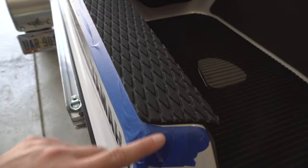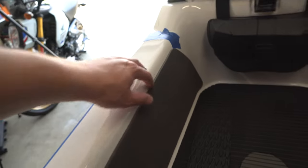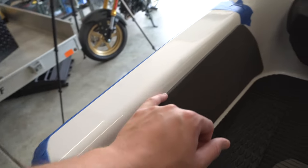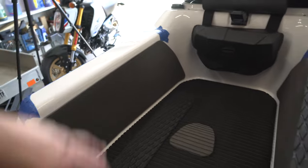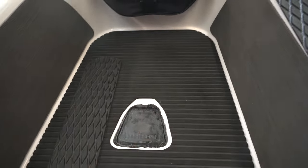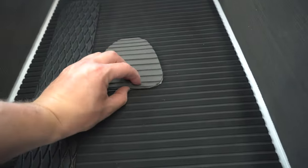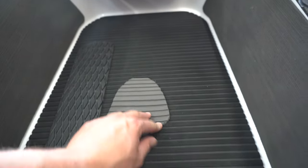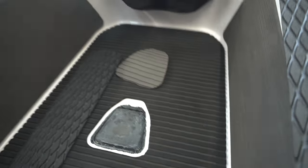If you're wondering what this blue tape is, it's the outline. We kind of lined it up and then taped off the edge where we're going to be applying contact cement to the fiberglass here. And then we're going to also be butting it up against the stock mat so that'll be a clean install. And the same with this — we've got the Pro Watercraft fill-in and we just siliconed this in, and then we'll also be contact cementing our little custom sheet that we cut.